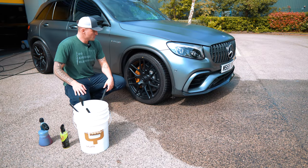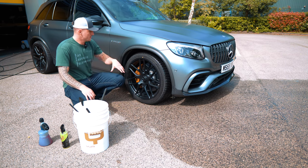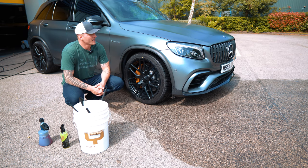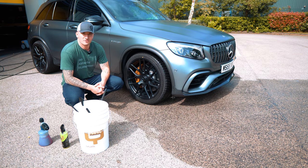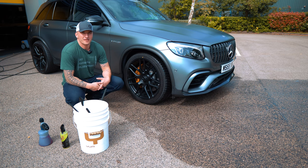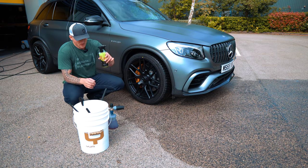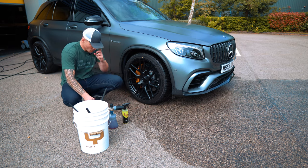That's it — very simple, nothing too harsh. All you need to do now is dry the wheel — whether you blow dry or wipe dry — re-moisturize and redress your tires, and you're back in business. Carbon ceramics, especially if protected, are actually a doddle to keep clean. You're just rinsing, cleaning, and drying quickly. Products used: Uniform foam at 10-to-1, PF22, Yum Citrus at 3-to-1, Undress tire dressing, and your standard wheel cleaning accessories.